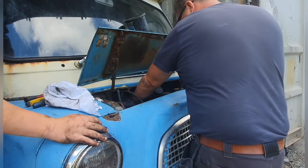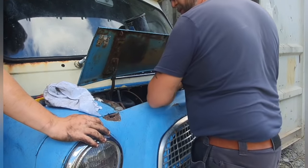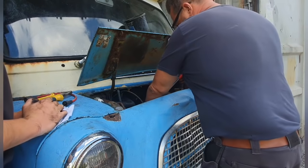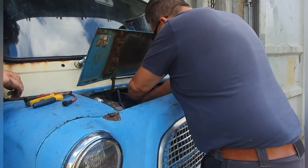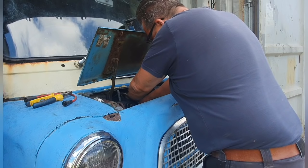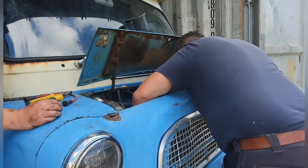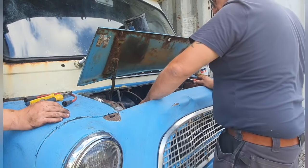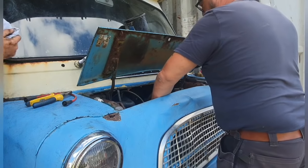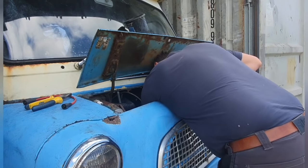Wait a minute. Put it over, mate. Lost all spark. We nearly celebrated, didn't we? Ignition on, please. Ignition on. Is it on? Yeah. Red light showing? Yeah. Yeah, we've got no life here at all. Dead. I'll turn the ignition off. Oh, that's why. Why? Leads off the coil. It's in my hand. Can I turn the ignition off? Yes, please. Right. Well, that wouldn't help. Certainly wouldn't help, no. It's got caught round something and it pulled off, I'm afraid.